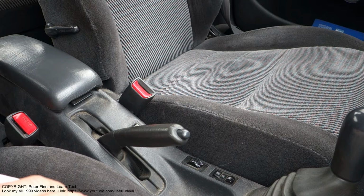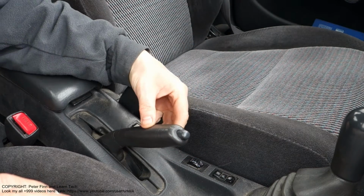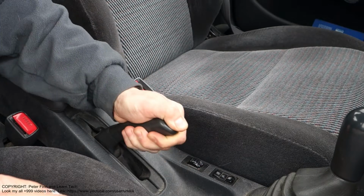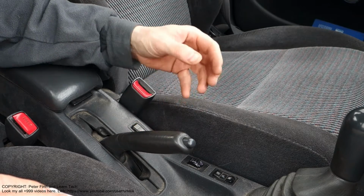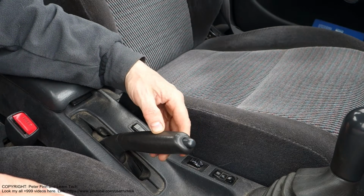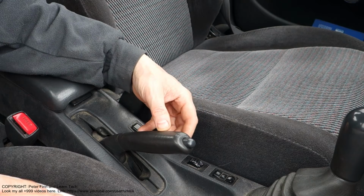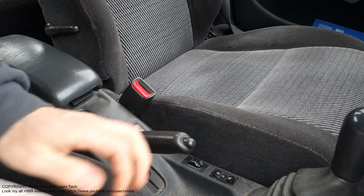And the fourth and final thing is that the handbrake, those braking shoes and braking pads, are so worn out that we need to replace those. It is also a possibility. But now I will show you the most common issues if we have a hard moving handbrake. The first one is that we need to replace those handbrake cables, and then maybe also lubricate those moving brake parts in this brake drum area. Okay, and then I'd like to show you how to do those things.